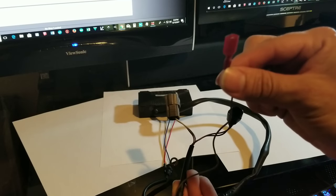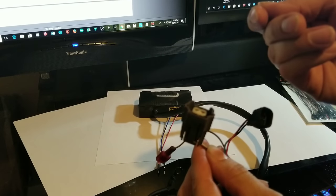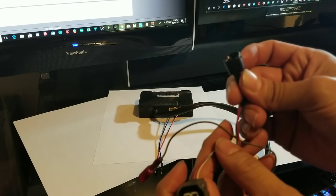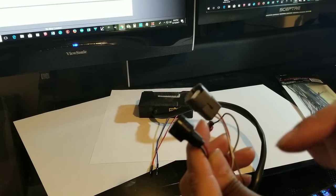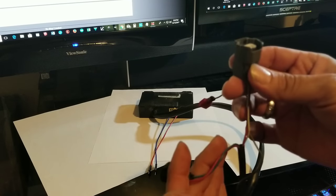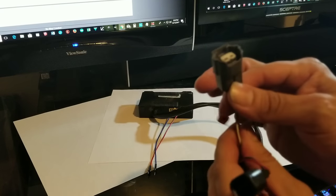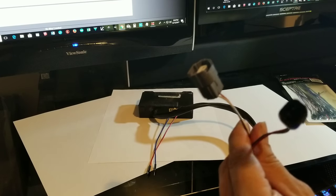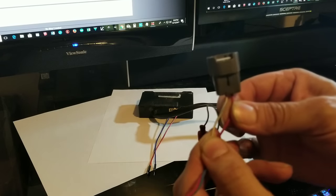At the end of the harness — on cylinder one or four — there's a clip you'll need to T-tap into the TPS to get its signal. To connect it up, you simply unplug your injector, plug your injector into the harness here, and plug this back into the bike. So you plug the harness into one of these connectors and plug that one into the fuel injector. Power is given to the power commander via the red cable.